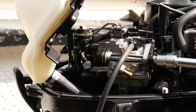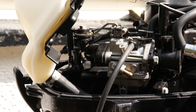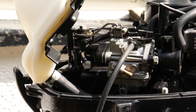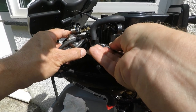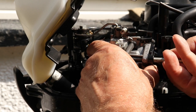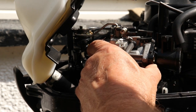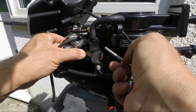Now it's time to loosen and remove the two bolts that hold the carburetor onto the inlet manifold behind it. Ease them out carefully by hand and make sure you hold the black air intake gauze unit firmly — it will spring off and it has a hidden nut inside it which could fall out.